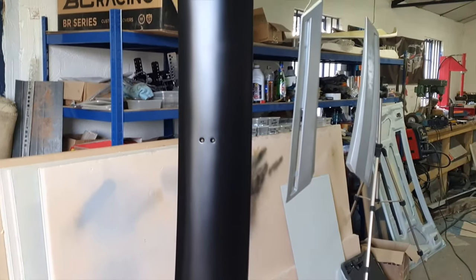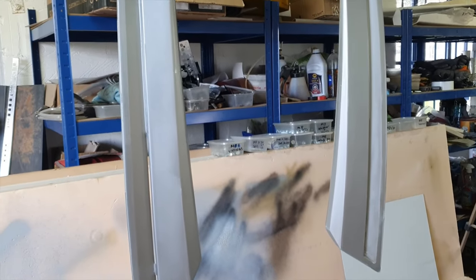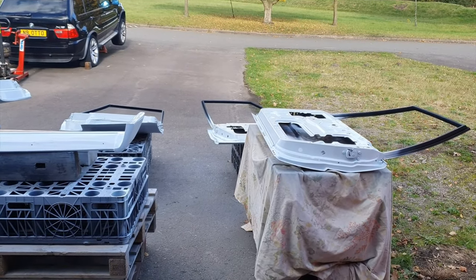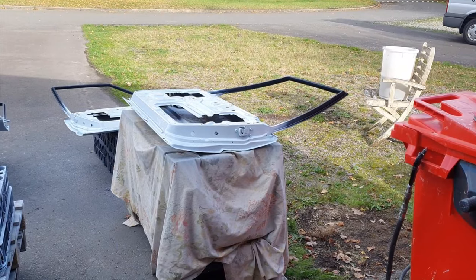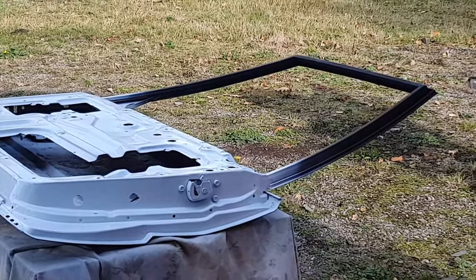What I'm doing now is just a few bits and bobs of painting - we've got the doors off and I've been spraying the rear spoiler, the gurney flap deflector on there, the back C-pillar caps, the little vent caps that go on there. Outside we've basically got the doors and the rear spoiler - I've sprayed the backside of those. The other side has all been prepped, so all I've got to do now is flip it over and spray the good side. Following that, the only thing I need to do is mask off the frames - they're going to have to be masked back and then we can spray them with some black satin.